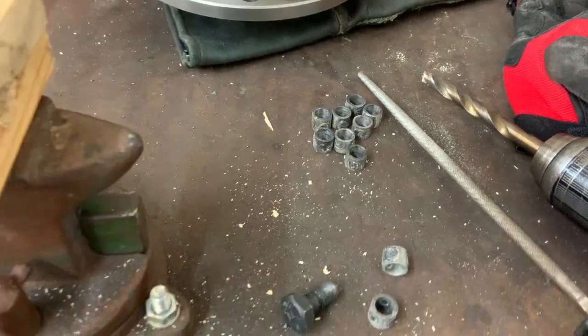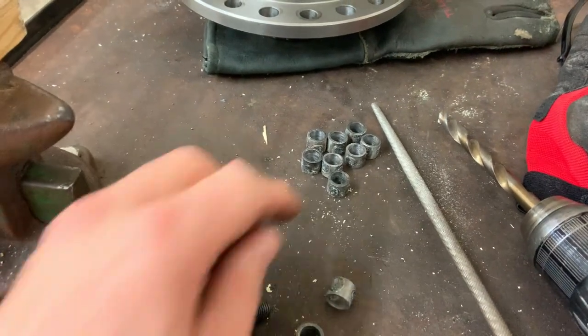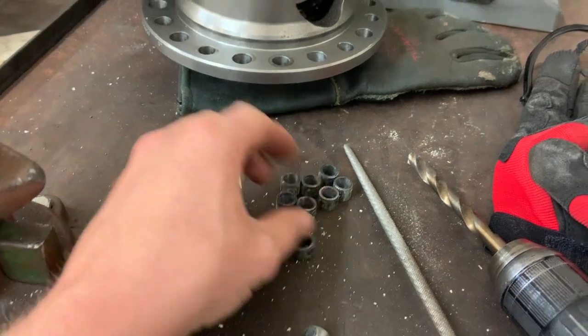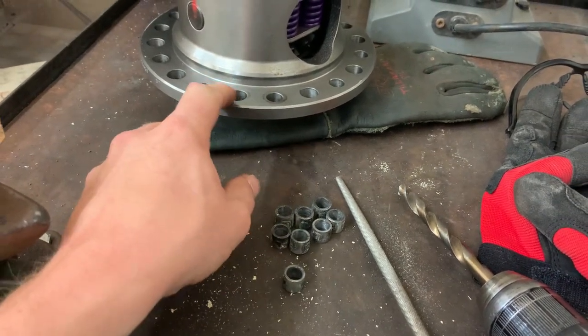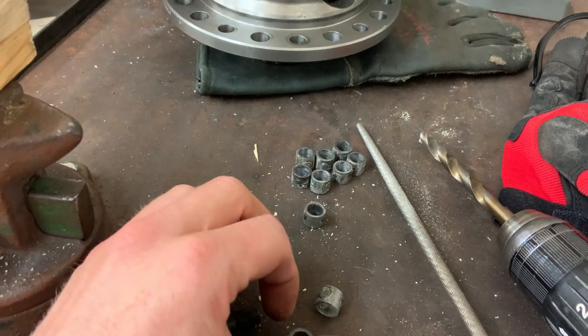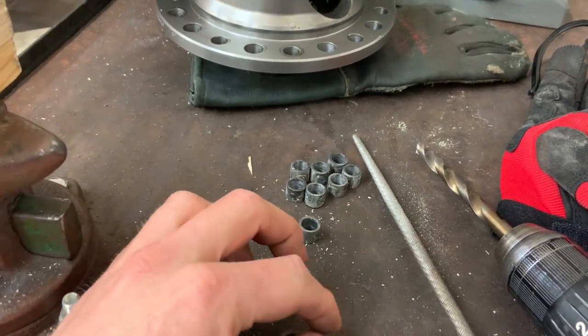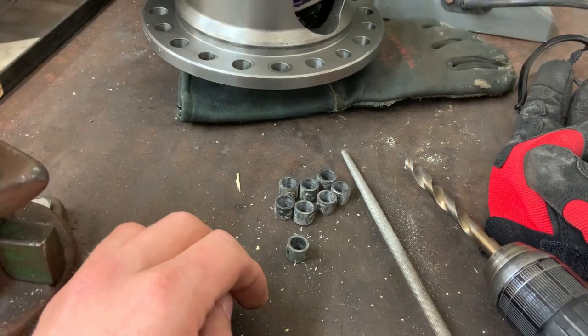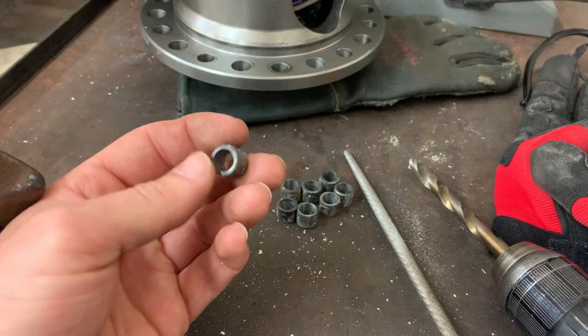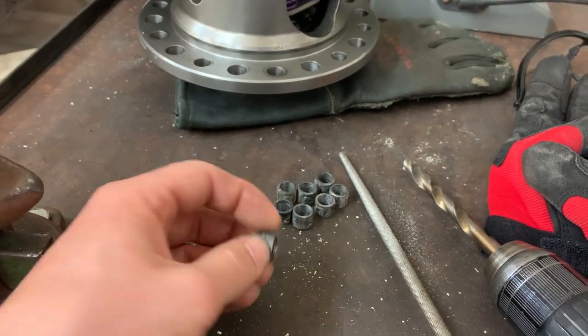All right, the next step in what I'm doing here is I got all these cut and they fit just a little loose in this half inch hole because of the clearance built into these holes and I don't really care for that. So I'm going to try a trick that I did on the lift arm bushings of the Jubilee a while back. I took my sleeves and I put three tack welds on them, which I'll have to grind down here in a minute.